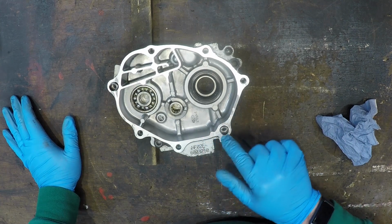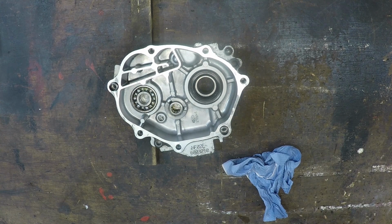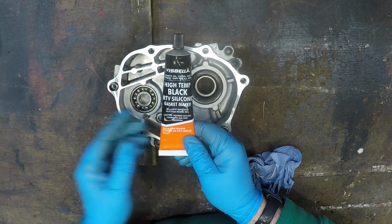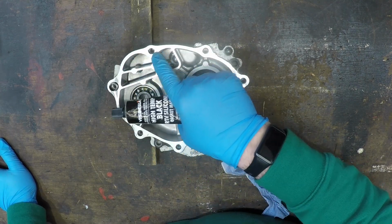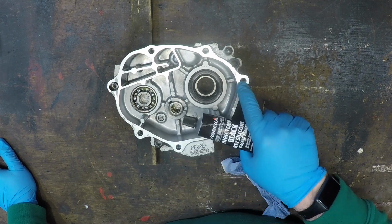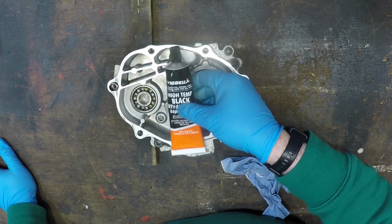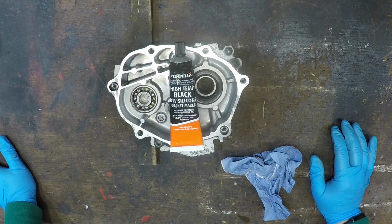This needs the new sealant applied, which is in my pocket to keep it warm. That's that stuff. Oh, wrong way around. That's this stuff. Basically put a 2mm bead all the way around this and around the bolt holes apparently. And also around the fixing studs, obviously. So we put the 2mm bead all the way around that. We put that on immediately,